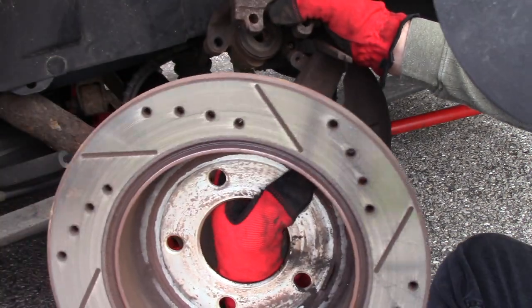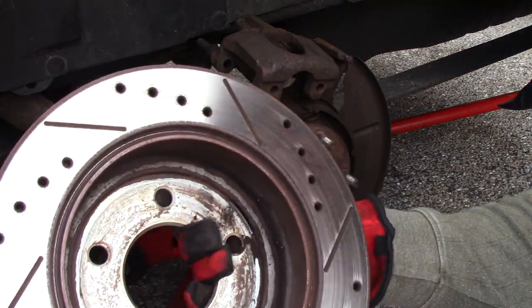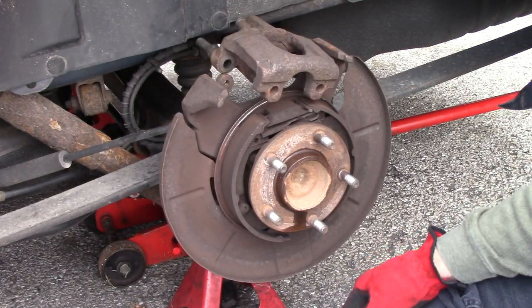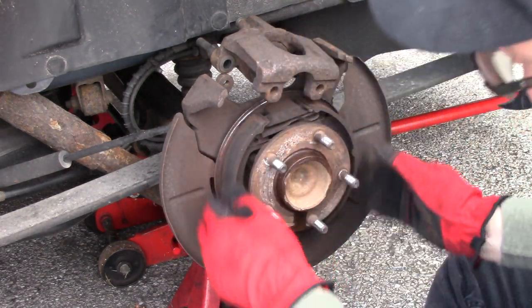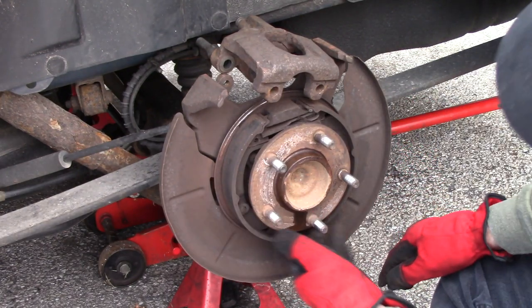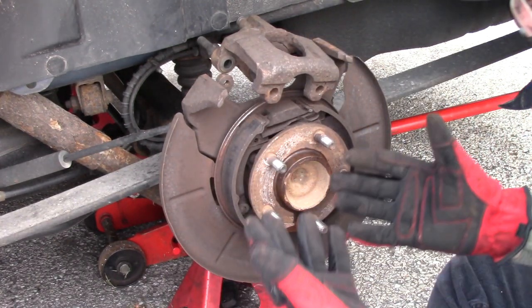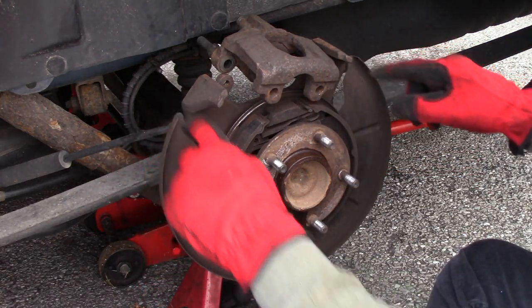Here's our rotor and here is our emergency brake drum, basically. You can see there's a line of wear in mine. They're nice rotors, but the holes are starting to crack from heat. Now is a good time to inspect your shoes. These are still in relatively decent shape because it is an emergency brake and I don't ever use these. Check for any rust or cracks — these two vents are supposed to be there.